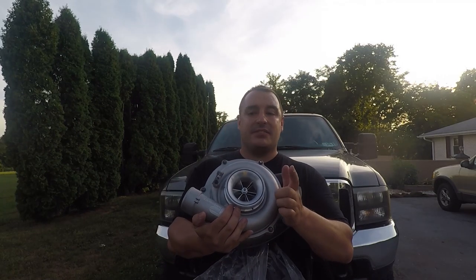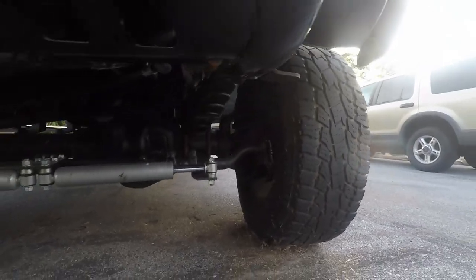The 10-blade turbine wheel gives you a lot of that fun, well-known, iconic 6.0 Power Stroke whistle. The 13-blade will quiet it down a little and give you faster spool-up, but up top it won't perform as well and you could deal with higher exhaust temps. The Velocity Port gives you some cool sounds too — I believe it helps smooth the airflow in, and I really like the execution. It's something a little different from what a lot of guys are doing in the VGT world.